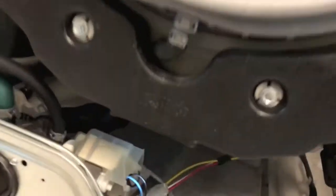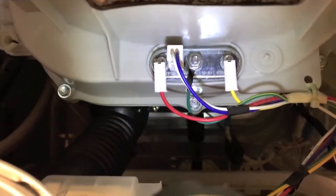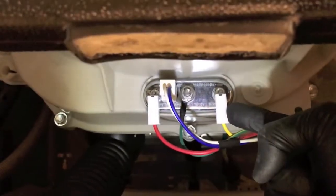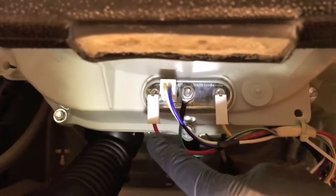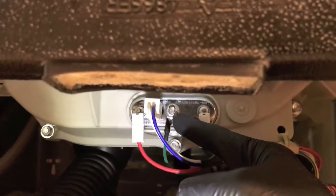With the front cover plate removed, reference the bottom portion. Come all the way down and up under the washer bowl — there is your heating element right there. What we want to do is remove the right connection point, the left connection point, the connection point for the thermistor or thermostat, and the last one is the green ground wire.